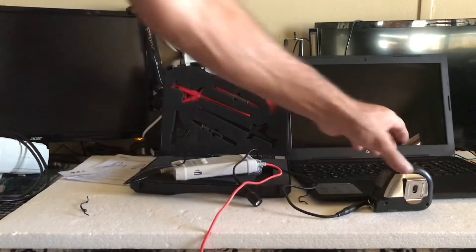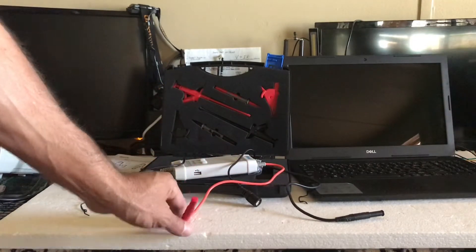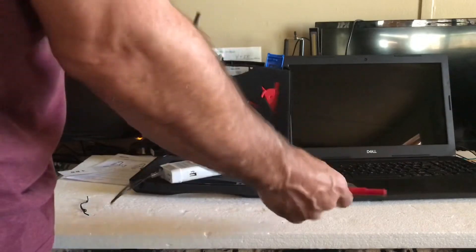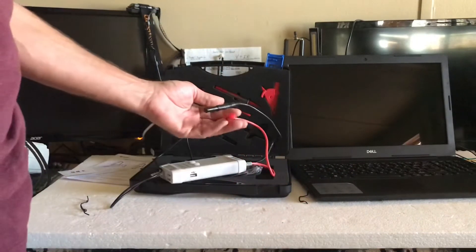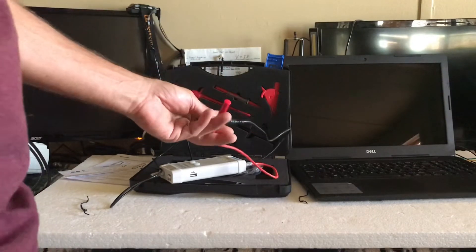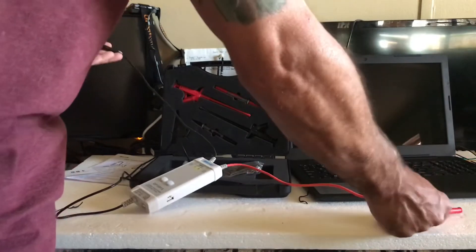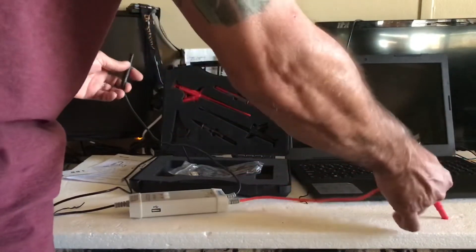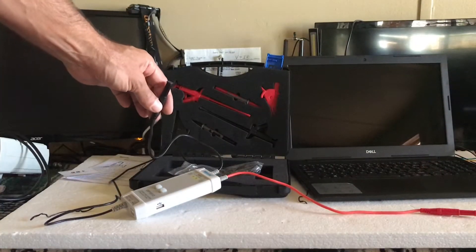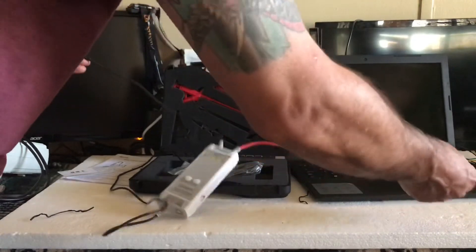So 17 inches — that's going to be a problem. I sure wish those were a couple, two or three meters. The reason I got this is for voltage drop. My wife's car — I think she just needs a battery, but I'm going to test the alternator. I'm going to want to test from the battery positive to the positive going into the alternator, and from the battery negative to the case. I'm going to be wanting to reach a little further than this.